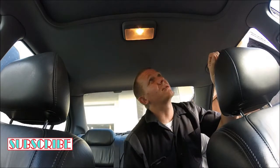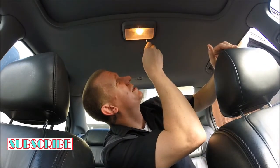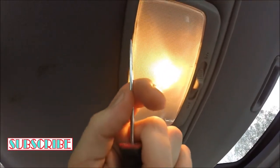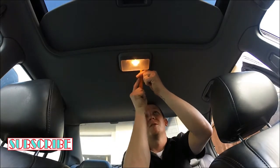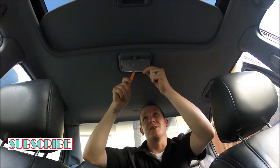These lights are generally super easy to pop off. I've gone through and looked at them to see where the tabs are. You can usually see - like on this one right here, there's a tab right there. You want to put a flathead in either side. I'm gonna use this flat pry bar. The longer flathead does work but this one is pretty short and I'm not comfortable with it. I feel a lot more comfortable with the pry bar.